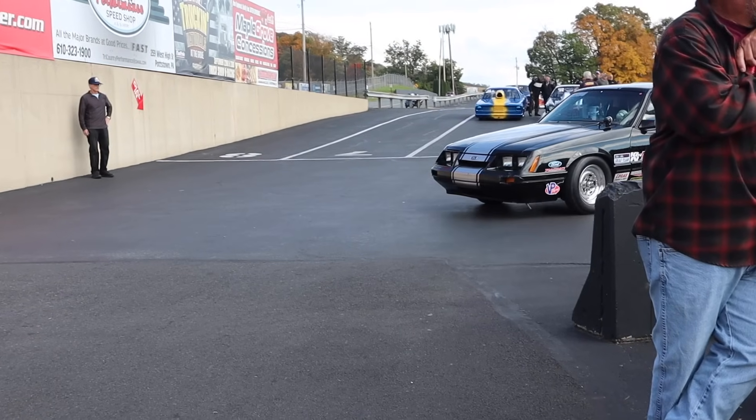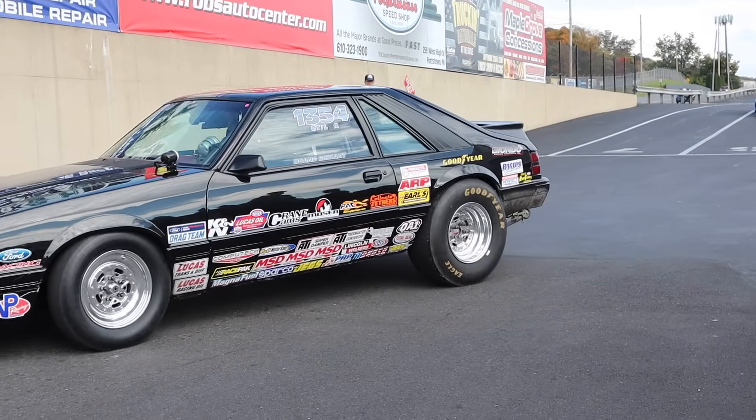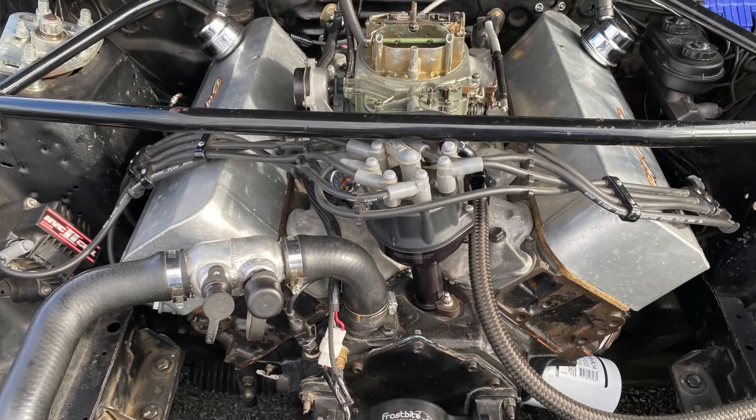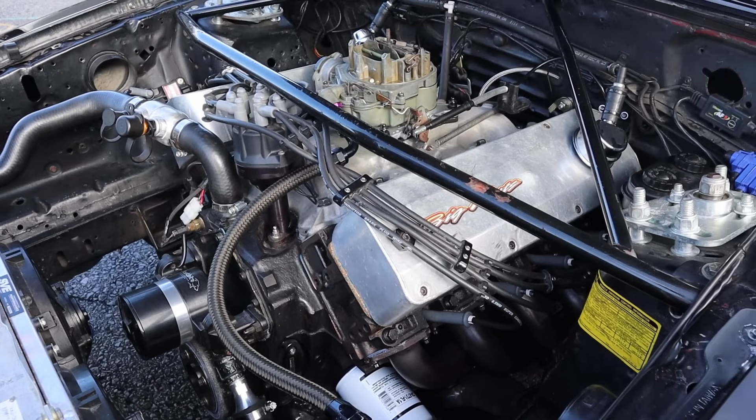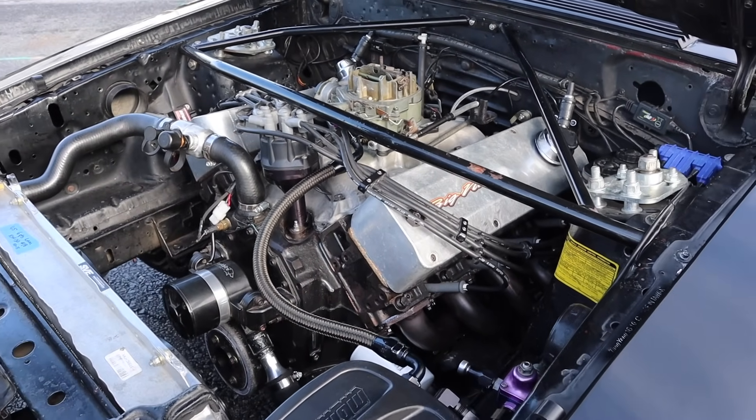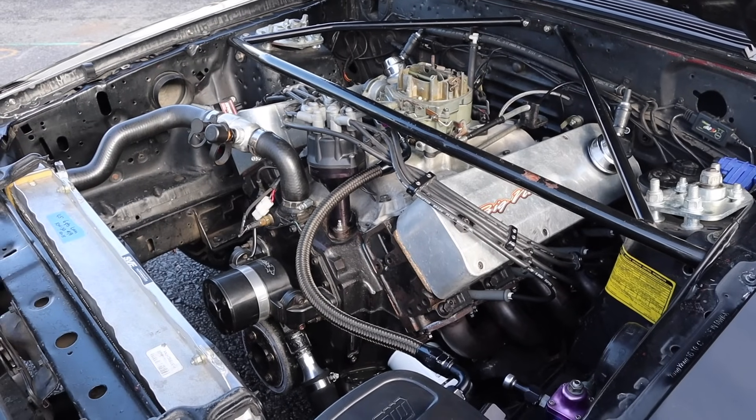It's a passenger car engine — what it would have come in: Cougar, Montego, Mustang, Ranchero — pretty much anything Ford had back then, four barrel or two barrel with the Cleveland. Now in Superstock, you can do a lot more than stock eliminator. You can have ported heads but you've got to stick with stock valve sizes, and you can do any camshaft or valve train. The camshaft is still the 481/490 or 480/491 camshaft. Dish pistons, stock ring combination, stud-mounted Crane rocker arms. It's a pretty basic combo — and it'll still pass stock eliminator specs.